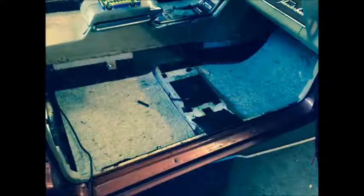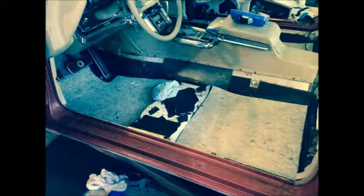Just some reflective insulation — it kind of matched the fiberglass reflective insulation from the factory. I saved what the mice didn't destroy, just to use as a template, and put it underneath the rear seats to keep this car quiet. Extra jute mat underneath the carpets. What they include for jute backing on the replacement carpets is shameful compared to what they came with from the factory, so I really used a lot more.